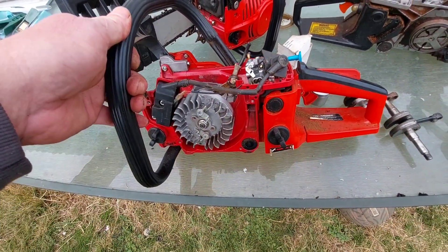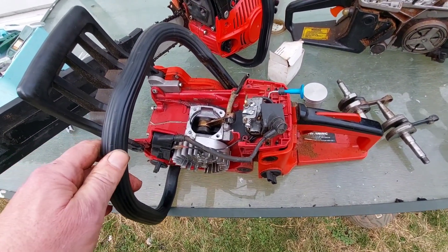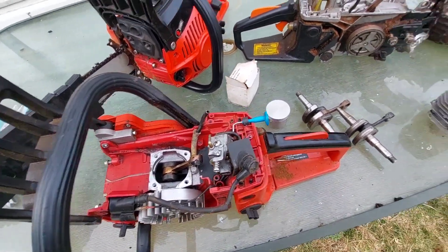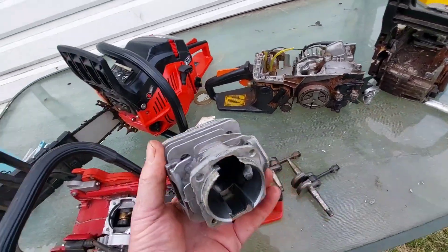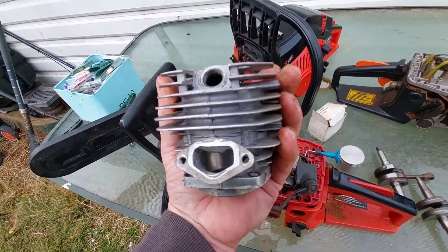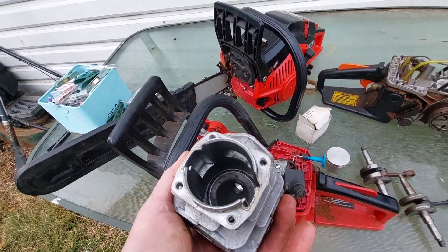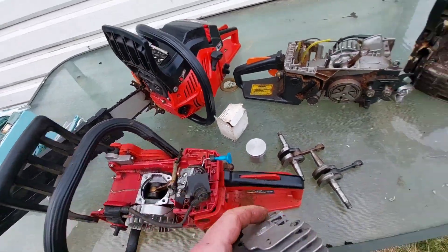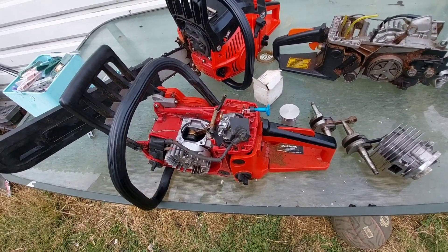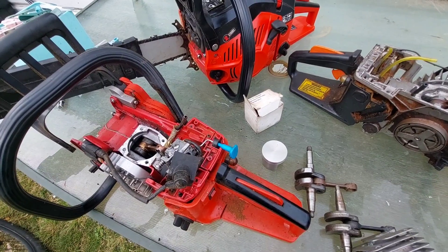I'll put it on this saw here because it's my spare parts saw — I've got all the parts. I prefer to have a better cylinder. I haven't got a four-transfer, so I'll use this twin. This twin should work alright. I had pulled this one, so that's been sitting a long time. But if I can get more compression, this will be a screaming demon. Alright, that's the idea: 52cc crank in a 62cc cylinder, with a Stihl 036 piston. Alright guys, over and out.